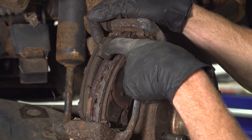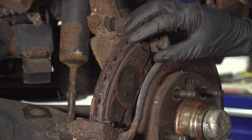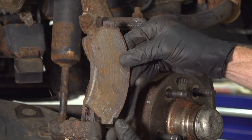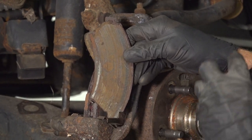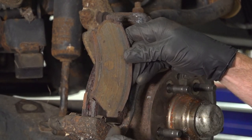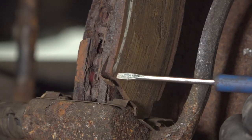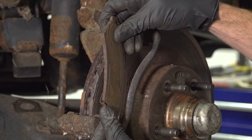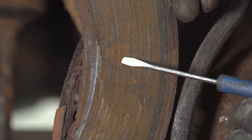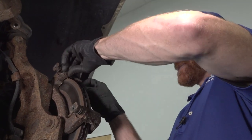Heat marks aren't necessarily very bad, but they could potentially cause a noise — something to pay attention to. If your pads were stuck inside the bracket, you're going to have constant friction on your rotor, which is going to slow down the car and cost you gas money while driving. Pulling out the other pad — it's completely shiny all the way around. It's missing the entire pad material on the metal backing. Also, down here is where the wear indicator is. A wear indicator causes a squealing noise when your pads get worn low, to let you know before you reach this point — which is very unsafe.